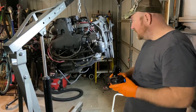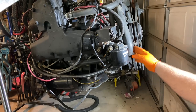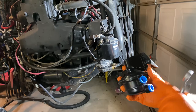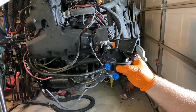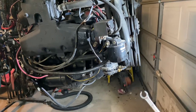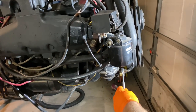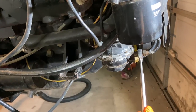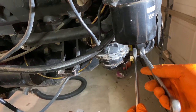We're going to get started right now. I've got the fuel lines here — the supply line and the one that goes up to the carburetor. The fuel pump is by Sierra; I ordered it online from one of the supply warehouses for boat parts. I'm going to start loosening the lines using a backing wrench. I hit them earlier with a little penetrating oil to let them soak in, and I'm using a line wrench to help keep from stripping that nut.